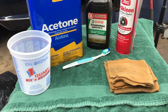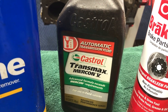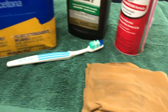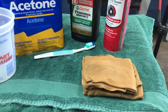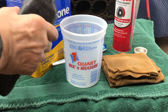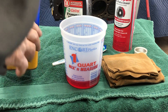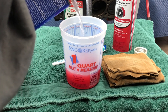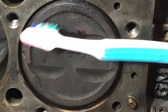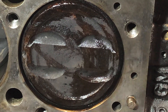As far as what I use to clean up the carbon: you're going to need some acetone — that's your main cleaning ingredient, available at the hardware store — some transmission fluid to mix with that, some brake cleaner, a small toothbrush, a mixing cup, and some lint-free cloths to keep any extra lint and debris from being introduced into your cylinder. Take your mixing cup and mix up about a 50/50 mix of transmission fluid and acetone. It doesn't really have to be exact. I think the acetone is doing more work than the transmission fluid. Then dip your toothbrush in the mixture and start putting a layer all around the perimeter and over the face of that piston.